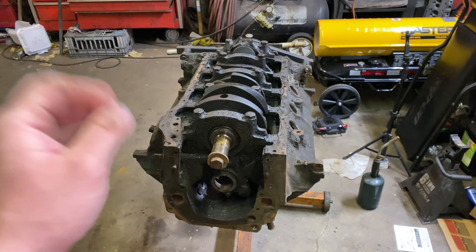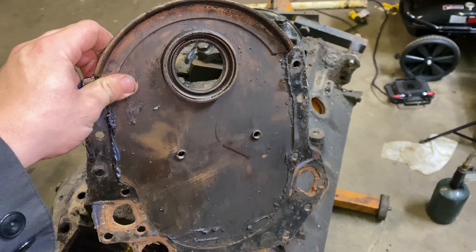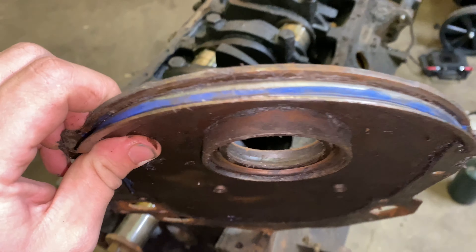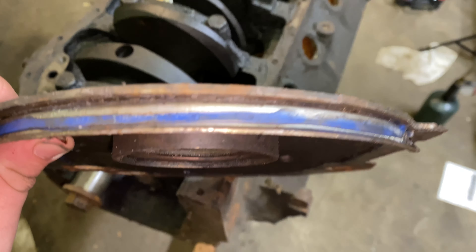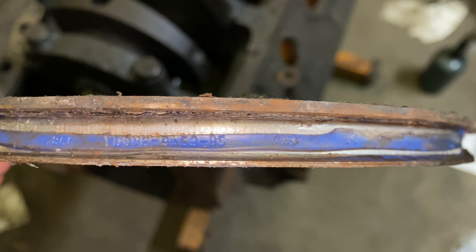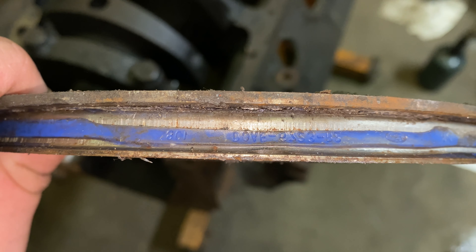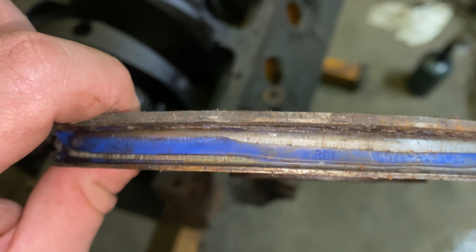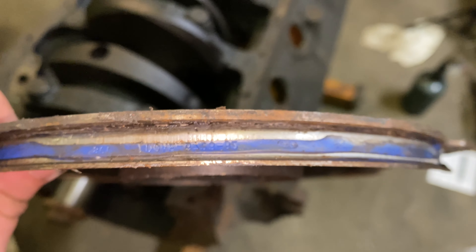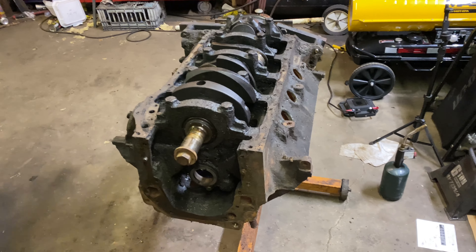This is an all original motor, never been built. Everything on it still has the original Ford stampings on it. For example, this is the timing cover here that Clevelands, modifieds, and 400s used. And this is where the seal goes, but apparently Ford used some kind of a sealer to help seal it. And you can see here in the glue that they used, you've got a Ford stamp and a Ford part number of DOB 70. So that tells you this has never been built — the timing cover has never even been off this motor before. It's pretty crazy. This motor is like 50 years old and never been built.